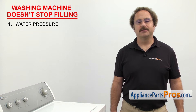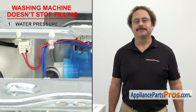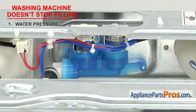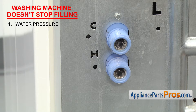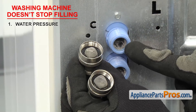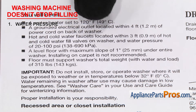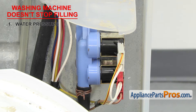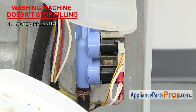The first thing we need to check is the water pressure. All washers require a certain amount of pressure to work properly. If the washer isn't supplied with enough water pressure, the water inlet valve may not close completely, and that could cause the washer tub to overfill. Before you check the water pressure, make sure the inlet valve and hose filter screens are clean. Since not all manufacturers are the same, you'll need to check the washer's user manual to see how much pressure it needs to work. If you don't have a way to test the pressure yourself but you still think it's low, you may have to have a plumber come to test it for you.